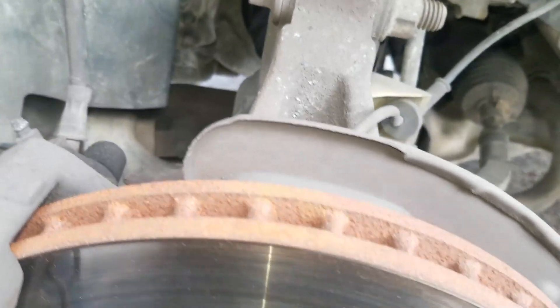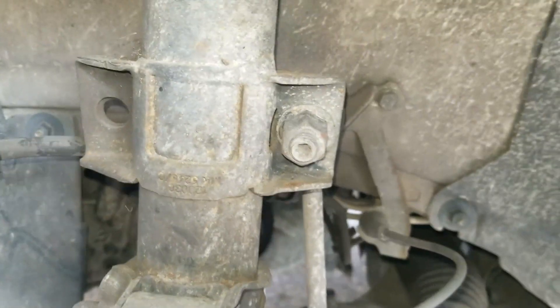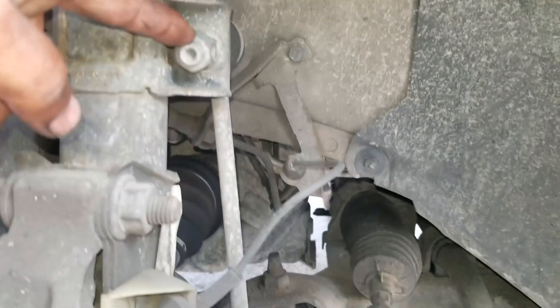Also, see in there that that ball joint is totally separated from the bushing. Hopefully this is one that we've got. We're going to take this strut loose, take this ABS wire loose, take that anti-sway bar link loose, and drop these struts. Hopefully we've got everything we need to replace them. I don't know if I ordered bump stops, but you need bump stops too.